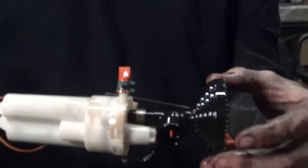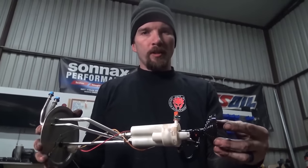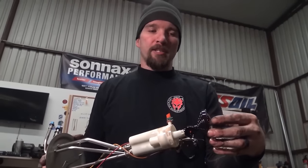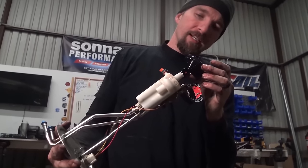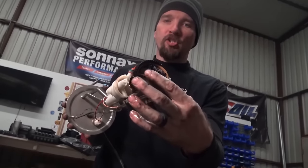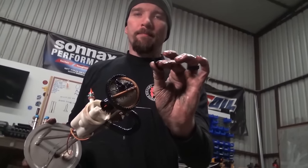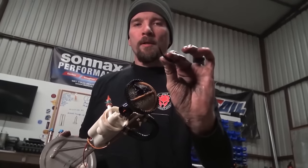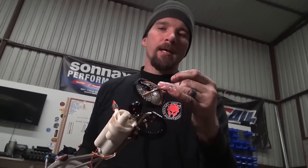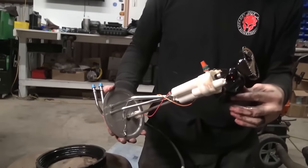In my opinion, what caused this was removing the sulfur from fuel and going to like an ultra low sulfur content. It really jacked up plastics and fuel lines and everything. Something else, I'm glad that we took this apart. You can tell there's all these chunks of plastic from something where somebody has been in here before. That looks like pieces of an old pickup tube that got sucked in here. So somebody's been in here and replaced this before, and when they did, they didn't bother to clean the tank out. And those screens that are in here look very, very healthy, from what I just saw.